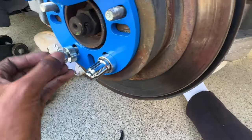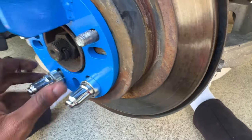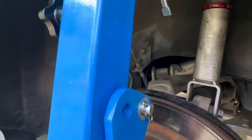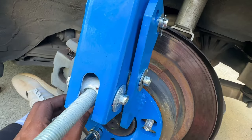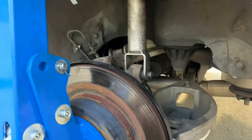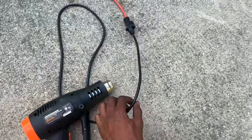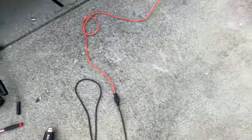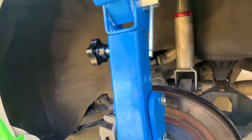I can't believe my lug stud is stripped — I literally just replaced that. Honestly this doesn't look too hard. I'll let y'all know afterwards if you should pay someone to do this, but honestly this looks like something you can do at home with a cheap fender roller yourself instead of spending hundreds of dollars. I gotta use heat so I don't crack the paint — even though I don't really care about it, I'll do it to make the job easier. I got the heat gun connected to an outdoor extension cord running up into the house and it reaches.